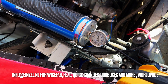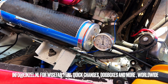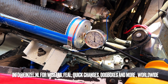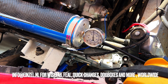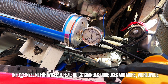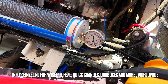If you have a car with really healthy oil pressure and run a little bit thicker oil, you may want to keep the pressure on the Schrader valve side a little bit higher, just to have more power to push that oil back into the engine if anything goes wrong. If you have a race car with super thin oil after it gets really hot — like 230, 240, 250 degree oil temperatures — you may want to make sure that Schrader valve pressure is never higher than 10 psi, because otherwise it won't fill up the canister anymore.